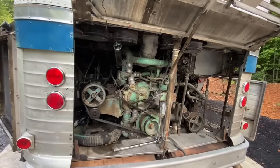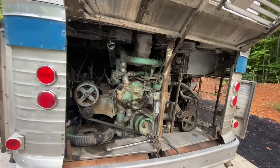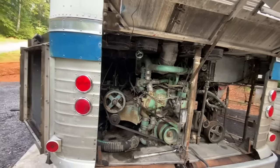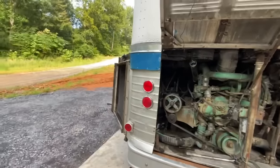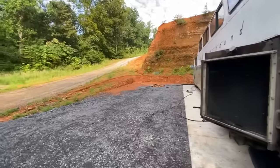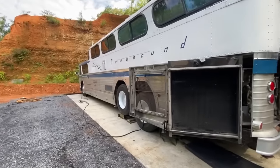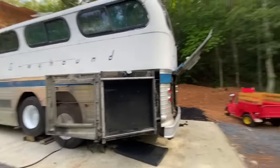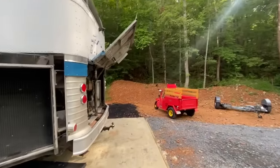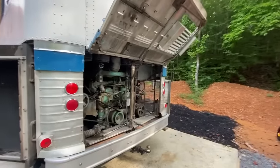Coming up, there's a big hill in Kentucky coming into Elizabethtown as you're coming south on I-65. He should have downshifted on that hill, and he did not. He thought maybe the automatic transmission would do it on its own. He didn't know about lugging on these engines. It slowed him down to right around 41 miles an hour, I think is what he said. And that was just too low of an RPM, too much heat trying to push up that hill. That's a real critical thing.